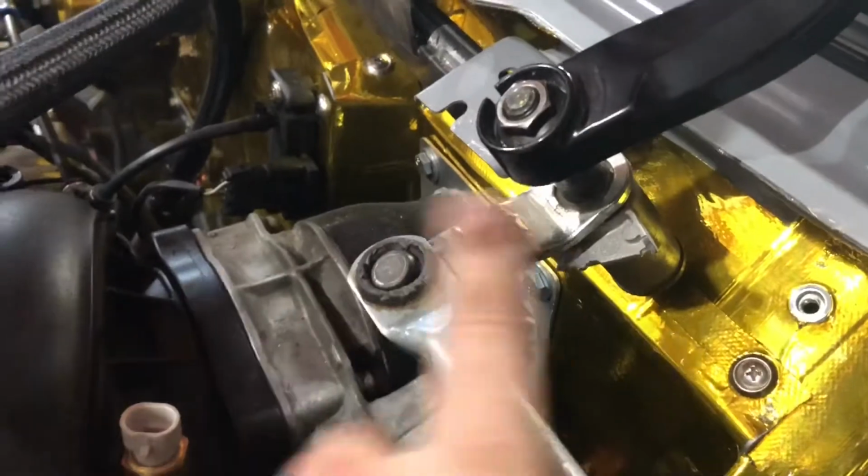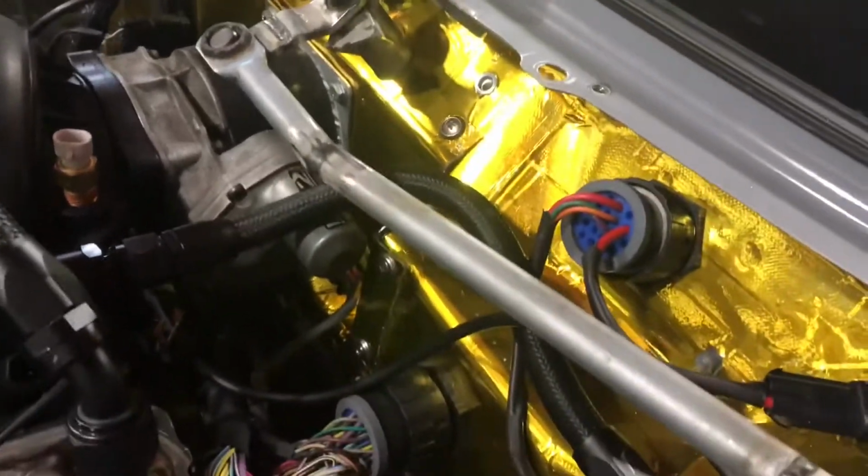So basically what I ended up doing is just wiring it up for single speed. I was able to mess with the linkage and everything on it, so I kind of changed the lengths of the pickups on the arms. Here where I actually cut this one and changed the overall length of this. I also put a bend in here and shortened this rod up a bit too. And by changing all that stuff around, I was actually able to change the ratio of how far the arms would swing and the amount of time it would take for them to swing at the consistent motor speed. And I think we're actually finally at a really good speed. Before it would rip itself apart, but I think now we're good.